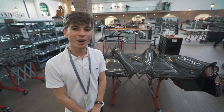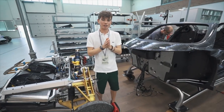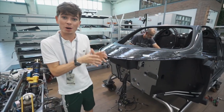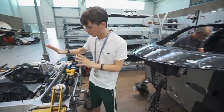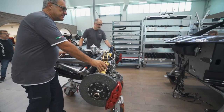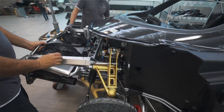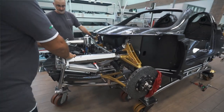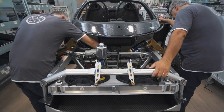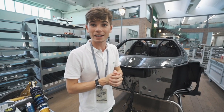A Pagani is actually built in three parts which can all separate: you've got the engine in the back, the middle section built of carbotanium — the monocoque — and then the front, all linked by bolts. What we're about to see is the front being married to the middle section, and that happens at the back as well. This means that if the car is ever involved in a crash, all three pieces can separate quickly to reduce inertia in an accident and limit damage to the car.